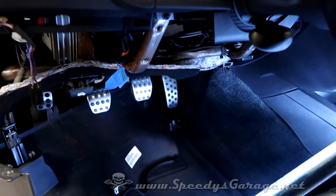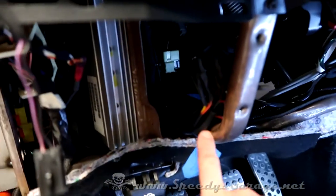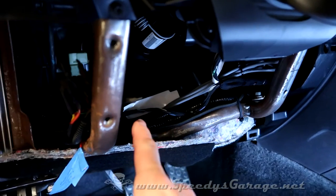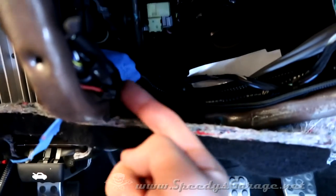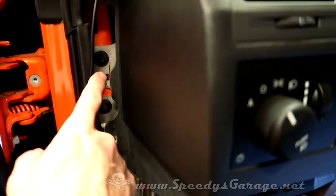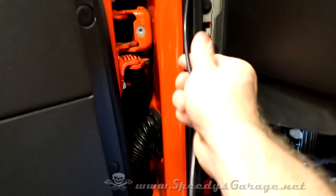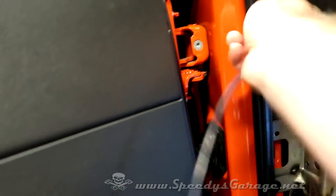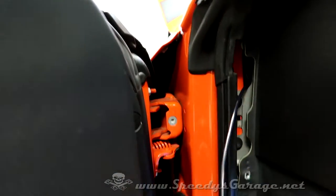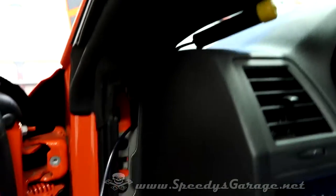I started removing the lower half of the dash to expose my wiring. As you've seen in other videos, I've got a lot of custom wiring under here. I've got a switched 12-volt source coming from a circuit boss, which I intend to use — that's going to be this guy right here where the blue tape is. I'm going to use that for power, and I'm going to use this bolt for ground. Because these wires are kind of running different places, I'm going to feed it back into that cavity behind the dash and give myself about 18 inches of slack so that if I ever need to pull the light out for adjustments, it's easy to work with.